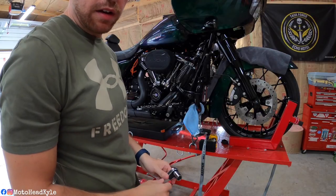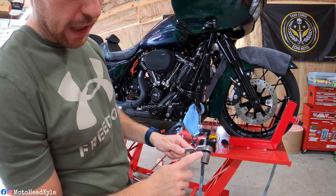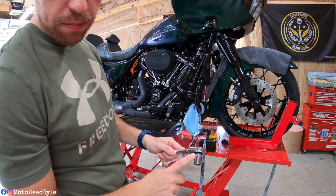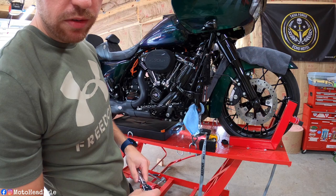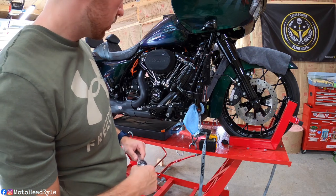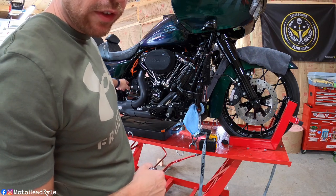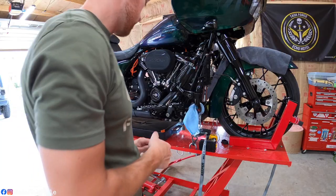But first off, I'm gonna get you guys set up on the tripod, and we're gonna start by draining the three oils and start with the oil change while the bike's still hot. So let's get to it. Just like on other bikes, you're going to be using a 5/8 socket for the three drain plugs, and then a T27 for the derby cover screws, and I'll go over the hex head that you need for the transmission drain plug when we get there.